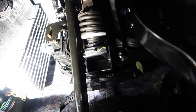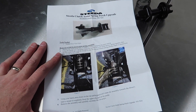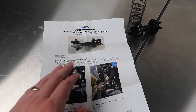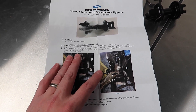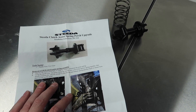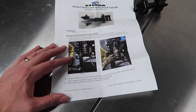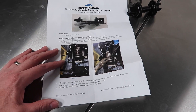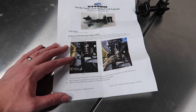I need to read the instructions. It says to press the clutch pedal fully to compress the spring assist, then use needle-nose vise grips to clamp the middle two coils of the factory spring together. They should compress the coils far enough so that the top and bottom of the spring perch begin to unseat from their mounts on the pedal. Using your hand, press down the spring perch and rotate the assembly towards the driver's seat to unseat it completely from the channel on the pedal.